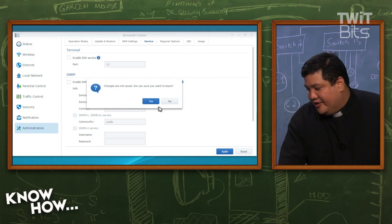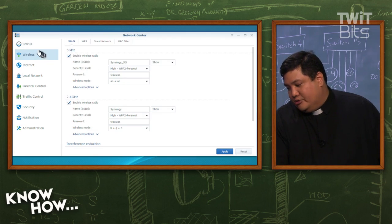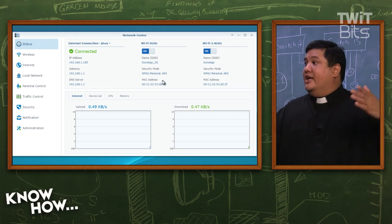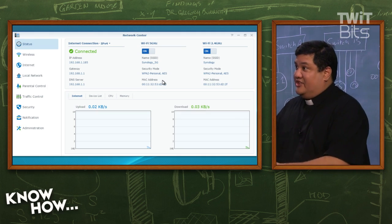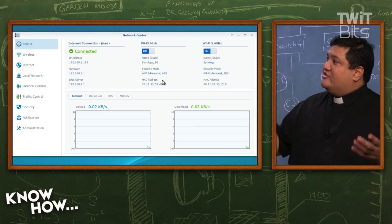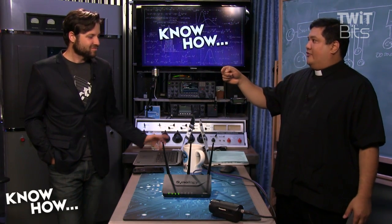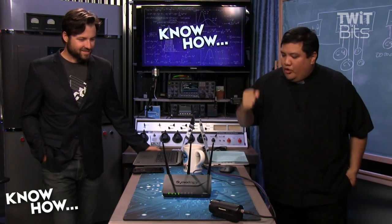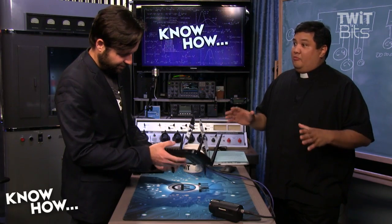There's so much in here — everything from how the wireless is partitioned to how I can turn on and off individual networks. I can turn on a guest network, just the 5GHz band, or just the 2.4GHz band. I love the fact that not only is there a switch inside the user interface, there's a hardware switch. So I have this mounted next to the door and I'm worried about IoT devices doing bad things — I physically turn off the Wi-Fi. The router stays on, but there's no more wireless.